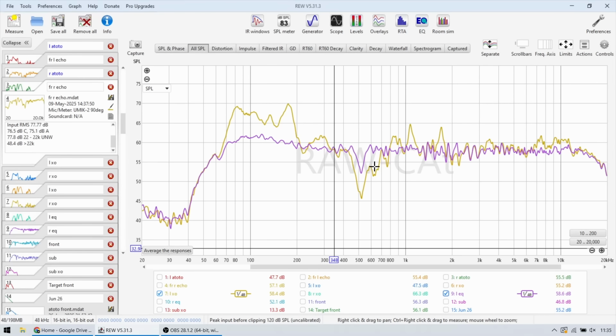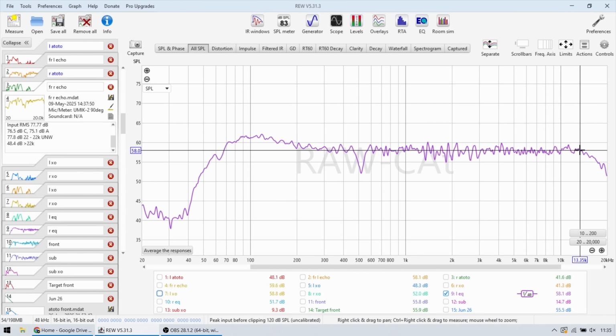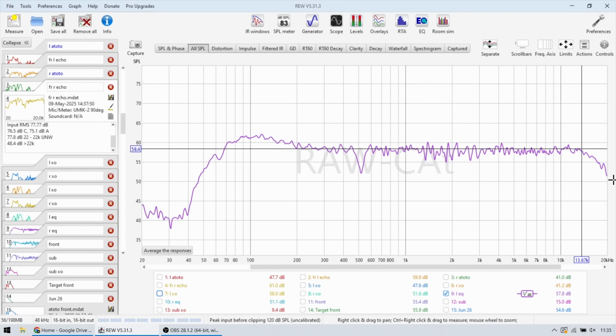I did boost this a little bit, 5 dB. It's fine, there's no excursion limits, no power limits, and just removing a few of these peaks from the tweeter range. And the response is kind of okay, kind of linear. Yes, the roll-off, as I mentioned, about 13, 14K, so you're missing that very, very top end. But again, the tweeter is in the door, very, very low and being off axis. So the left side is fine.